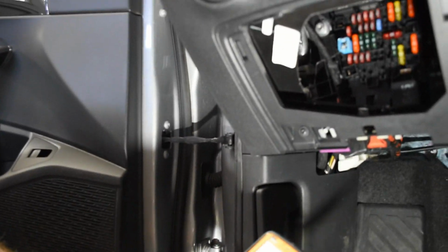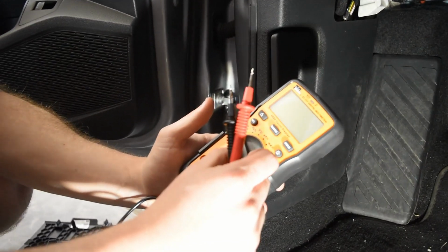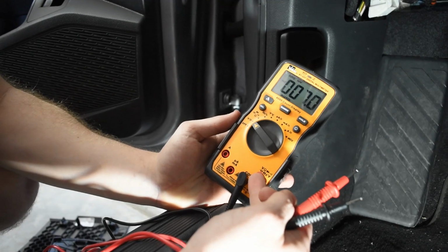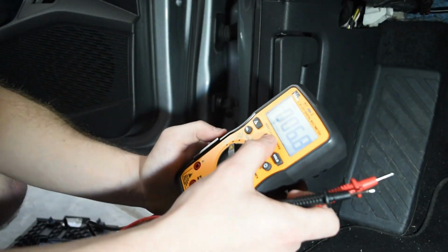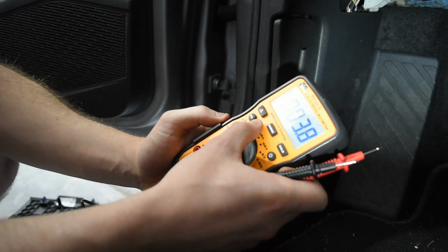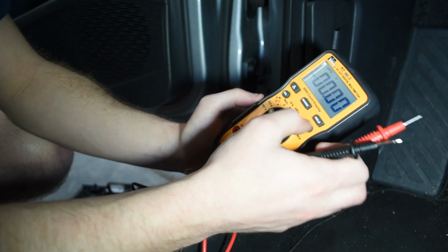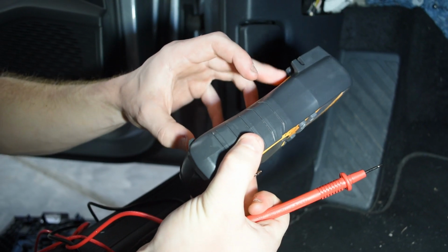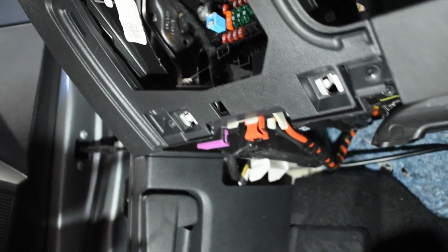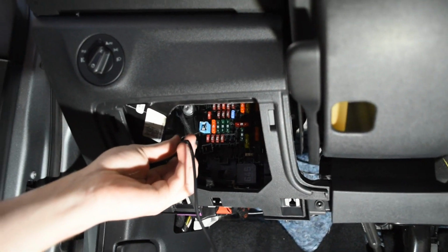All right guys, so I'm gonna be showing you the electrical side of it now. First things first, you wanna turn it on. You have your voltage plugged in here and your ground plugged in here, and we're gonna get the backlit for you. And then I need DC power, and then I need this selected. So this is going to read your voltage. A really easy way to do this is you can just ground it to literally any metal on the car.